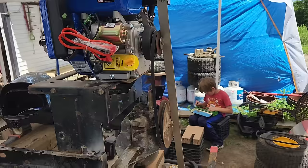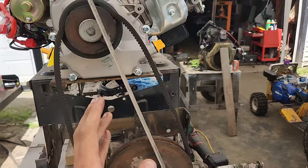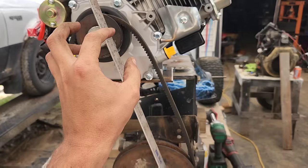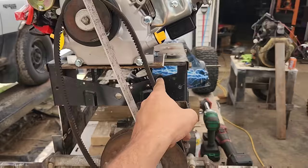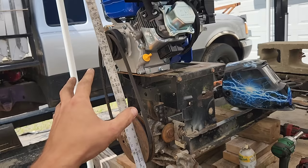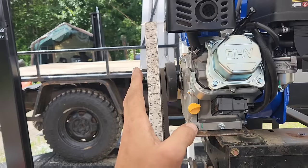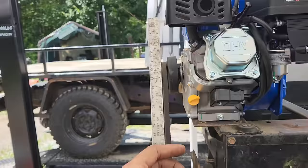One side note we might have to reconsider: originally this would have had an idler that went this way with a V idler pulling outward, but we really want it to wrap around that as tight as possible. So what we really should do is flat-idler it coming in this way, pulling it in - we might have to find a flat idler in the junkyard. We've set this up with two washers behind here for spacing so we can bring it in or out just a little bit for alignment afterwards. Then we're going to weld it up and drill it out, get it bolted in place.